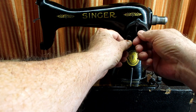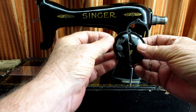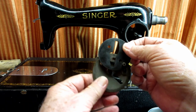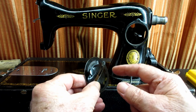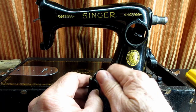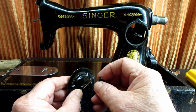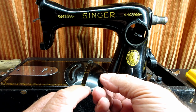I'm just going to put the reverse lever in the middle, grab those two plates and turn them so I can pull them off. Now here is the regulator plate on the back — you can see the kind of design here. The stitch regulating thumb screw is screwed through a slot in the indicator plate into the regulator plate. So while I've got this off, let me disassemble this and unscrew the thumb screw so you can see it. Let me show you the indicator plate and regulator plate first — very faint numbers: 6, 8, 10, 12, 15, 20, 30.